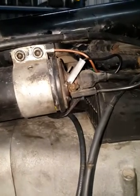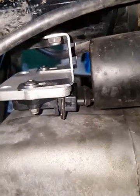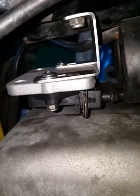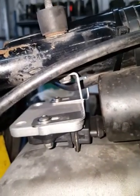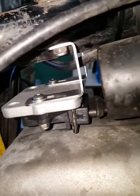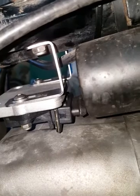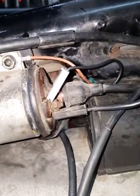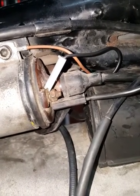This bike is still fitted with its original coils, which are functioning quite well. I've ordered new coils but they haven't arrived yet, so I decided to go ahead and show you the installation using the old ones — they work quite fine. The brackets come with the kit, as does the ignition module, and they bolt onto the bottom side of the tank mounts on a slash six or a slash five. The module then has a cable that comes out and splits into two parts; one part goes up onto the coil wiring, which gives you the triggering and firing of the ignition. You can see I've just piggybacked it because these old coils have got piggyback pins on them.